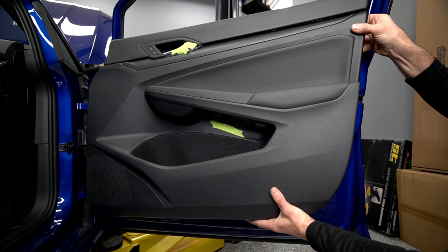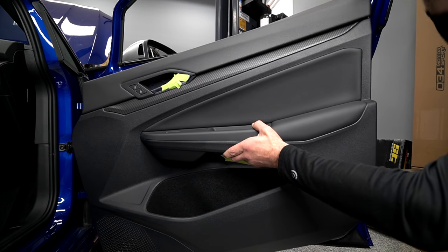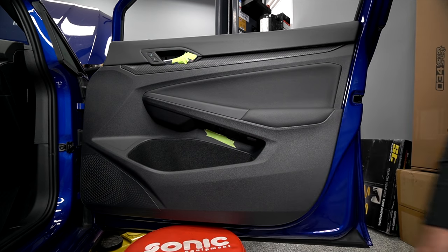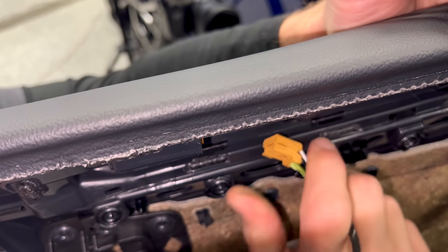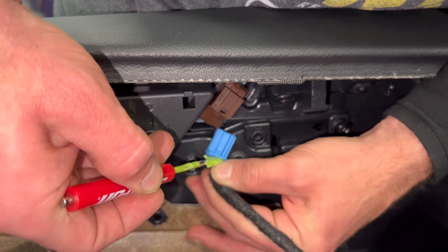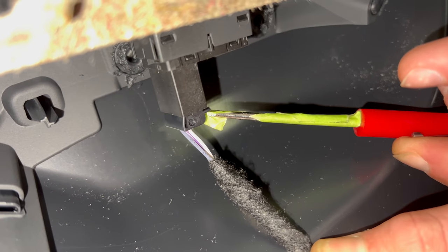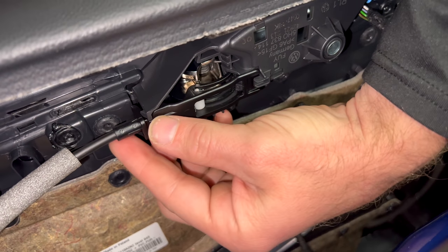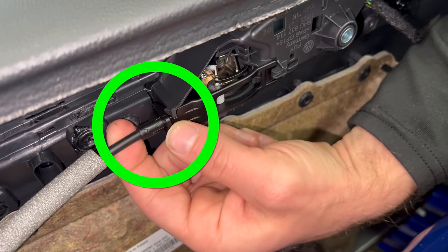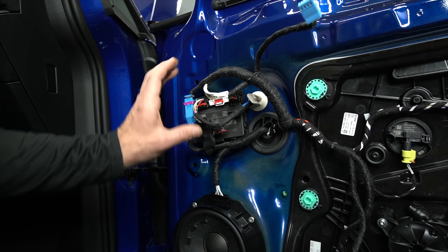Tap it up and you can kind of free it from the door. Now you've got a bunch of wires behind it — don't just let the door panel hang. Hold it while you take off the wires. If you have a rolly chair, grab it, roll it under, and set the door panel on it so you can get back behind to get your connectors. There are a handful of connectors on the back side of the door panel for things like the window switch, the interior lighting, and the door lock button. Those are all straightforward Volkswagen connectors where you push the lock and then unplug. If one's giving you a hard time, push the connector in more, then push the lock and remove. For the inner door cable, at the back side of the cable there's a small release tab — press that back towards the outside of the door, slide it away, and pull the front piece out of its channel.